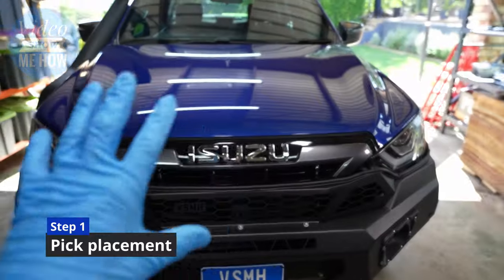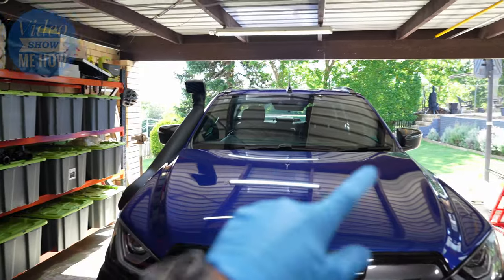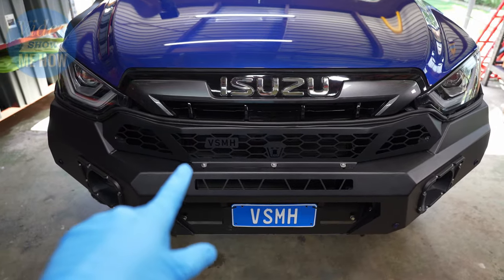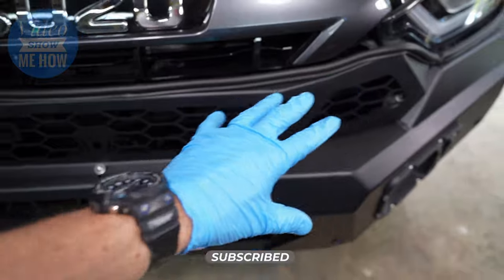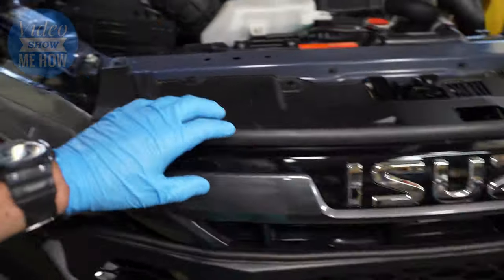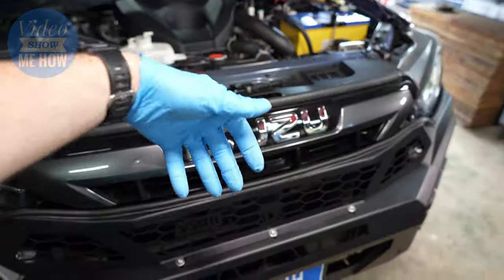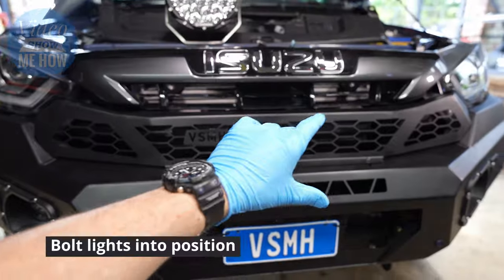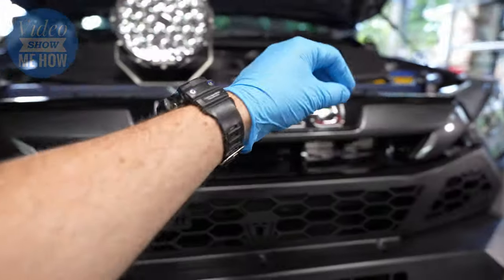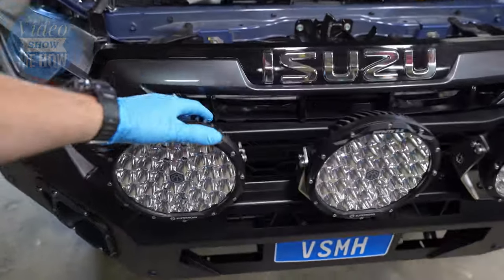Step one is working out where you're going to put these lights. Some people go the roof light depending on if they've got a cage, or pillar lights — but most people go bull bar. In our case we've got the hoopless design so we're going straight along the front. We have our little grill here that needs to get shunted back a little bit for our brackets. If you're doing the install on a D-Max, I recommend taking out the top plate to get nice access below to the back of all the wiring. Grab the stainless hardware and get those guys bolted down into position, then we can move on to the wiring.